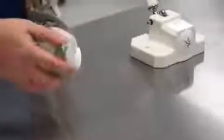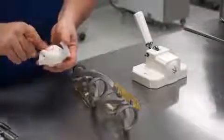We'll begin with showing the beater. In the middle of the beater is the idler. It's removed by pulling it out through the center of the beater and the center of the plastic end pusher. The next piece is your plastic end pusher. You'll notice that it is also notched with the beater to ensure that it can only be installed one way.